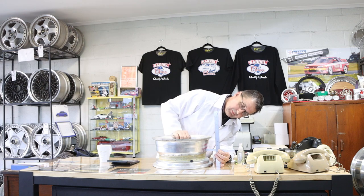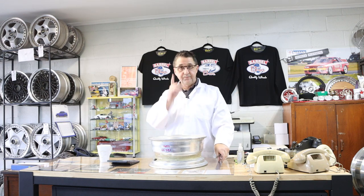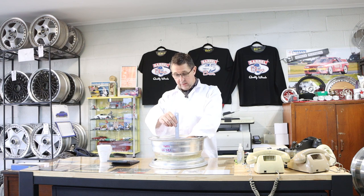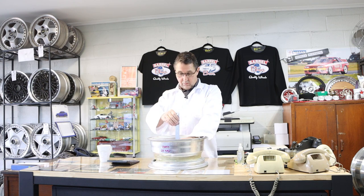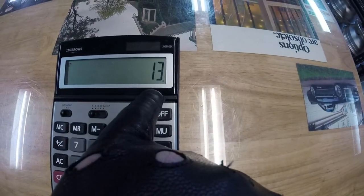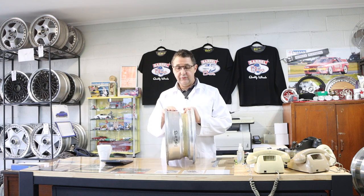So about where that little curve is — we've got the centre of the wheel at 89 millimetres. Now go down through the centre of the wheel down to the table, make sure it's flat, then measure across at the hub. That measurement is 76 millimetres. 89 minus 76 equals 13 — so that's plus 13 millimetres offset.